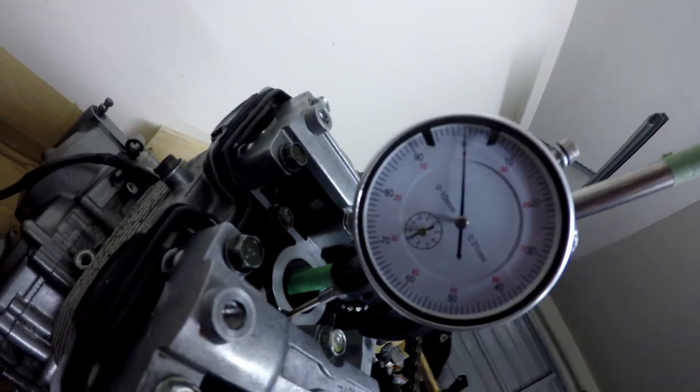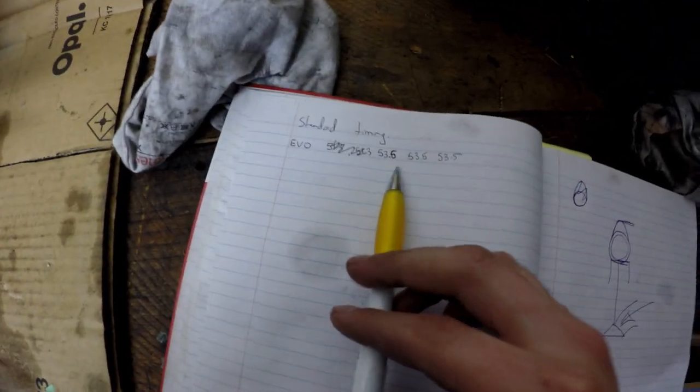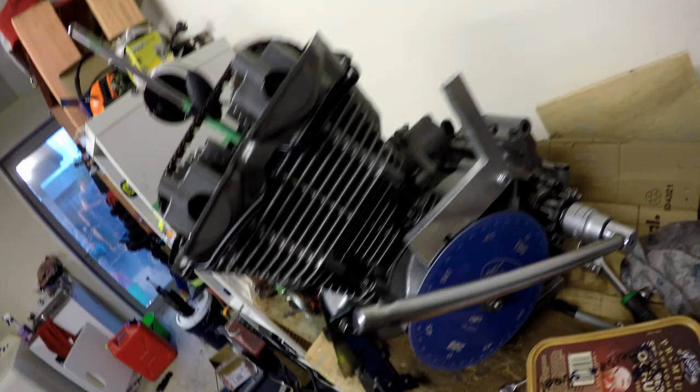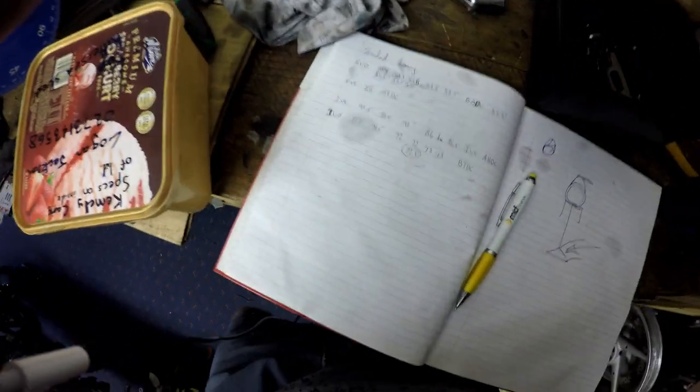I've wound the motor forward three times just till it sits on zero to figure out the exhaust valve opening, and I've done this three times — as you can see, I got three readings in a row the same. I've finished checking the last of the valve openings. We have — it's a little hard to read — when the intake valve opens, intake valve closes, exhaust valve closes, and exhaust valve opens. Now I've got to sit down and do some math to figure out where they are and how much we've got to move them.